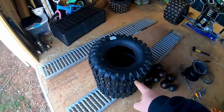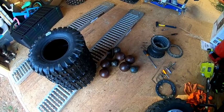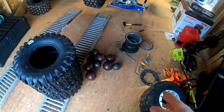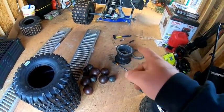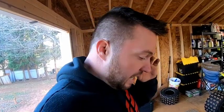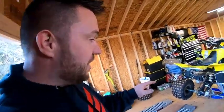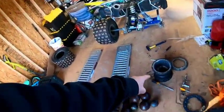Got the new tires — they had some balls in there, that's all they had in one tire, nowhere near enough to make it work. But I respect the fact that they tried. Whoever decided to torque the wheel absolutely just over-torqued it, stripped two of the bolts. Not a shoutout to the guy who did that to those wheels — I was actually very, very mad about 30 minutes ago. I've calmed down a lot, but I got the wheel off and hopefully the other one won't be as bad.